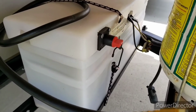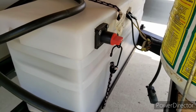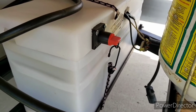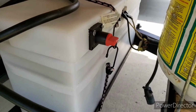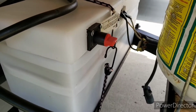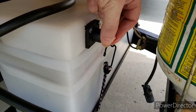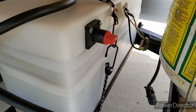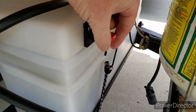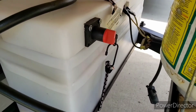And that brings us back here to this switch that I installed. So right now it's set to feed the trailer with 12 volt power, but through that same wiring is where it accepts the charging. So for me, I don't want it to charge or run off at 12 volt because I have the converter hooked up to my inverter, so I want everything to run through that. So I'm going to shut that power off, and we'll go inside and see what that did.